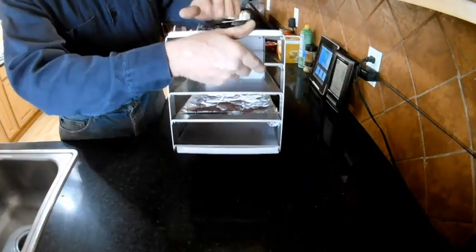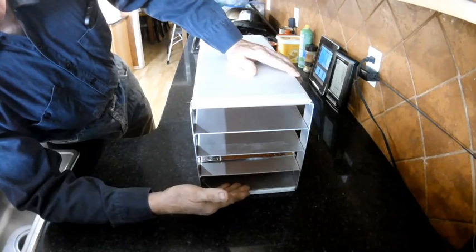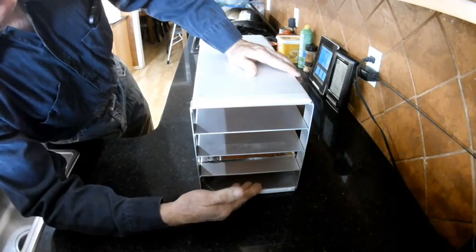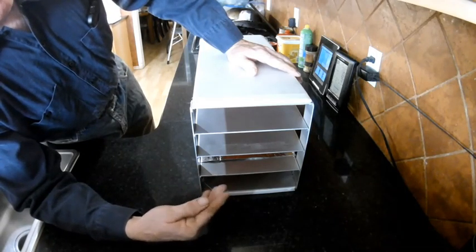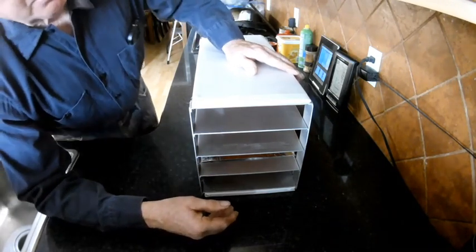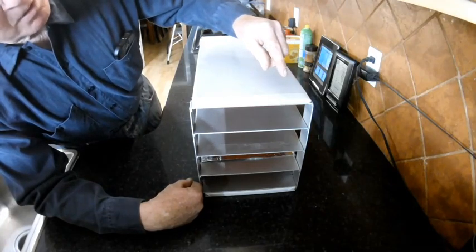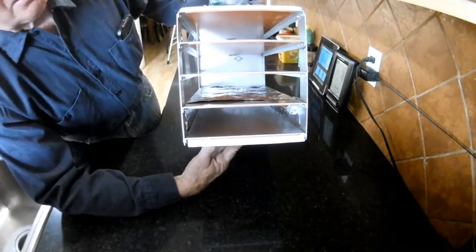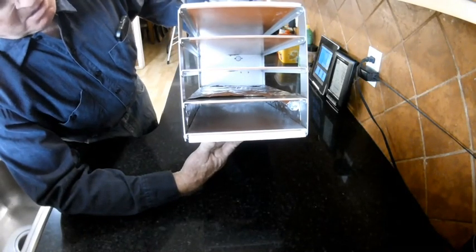So now what this will end up doing — not only is it going to retain some of the heat in this bottom shelf and heat the bottom shelf up a little bit to compete with the top three shelves, but with the foil on the side, for those who freeze dry in areas with high humidity, it's going to keep that ice buildup inside the chamber from coming into the bottom shelf. Harvest Right has also laid polypropylene corrugated material — one layer on top, and two layers on the bottom — basically to help insulate that bottom shelf away from the cold chamber.